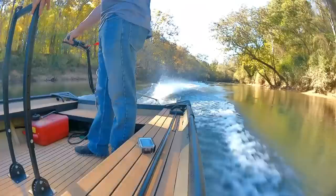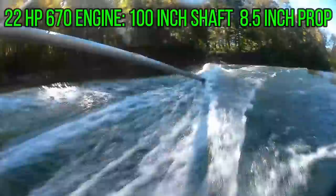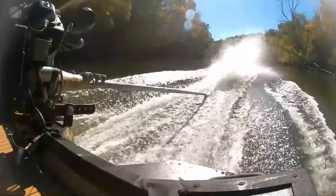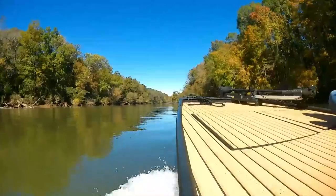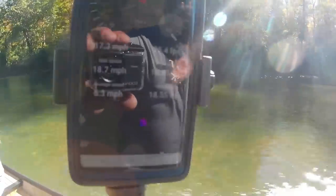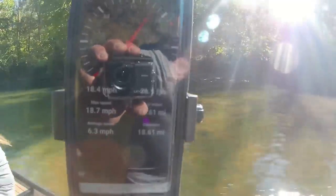And last but not least, we've got the 670 Predator motor from Harbor Freight. This motor does have a little bit of modification to it — it's got an exhaust and a Mikuni 34 millimeter carburetor, and I had to do those upgrades because the original parts on this motor gave me a lot of problems. With the modified 670 Predator 22 horsepower motor and a large Beaver Dam Mud Runners kit, I was able to get a solo top speed of 22 miles an hour with an average cruising speed of about 20. Adding a 180 pound passenger, my top speed dropped to 19 miles an hour and my average cruising speed was between 17 and 18. The one mile an hour range of cruising speeds is because it really depended on where the second person was sitting — you could move them around in the boat and pick up or lose a mile an hour. That's why weight distribution is so important when you're setting up your long tail.